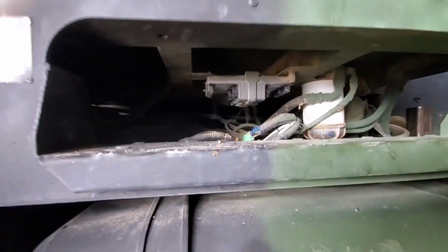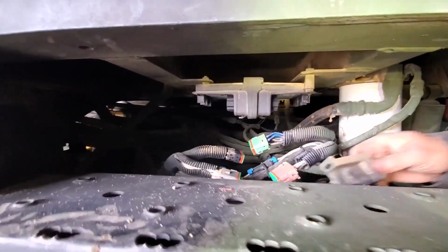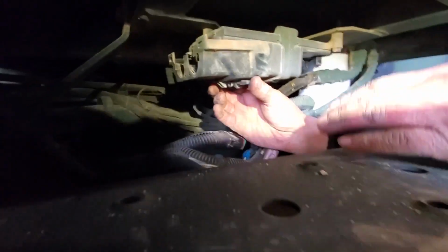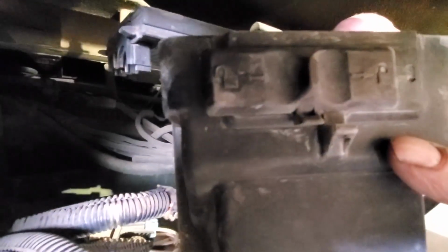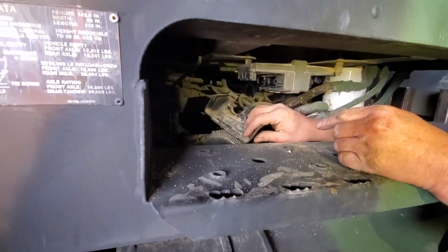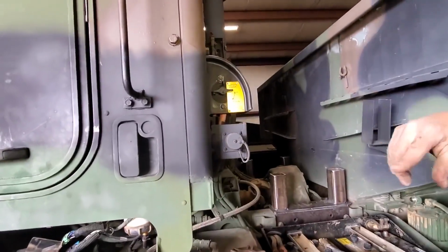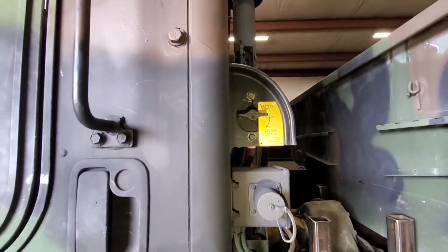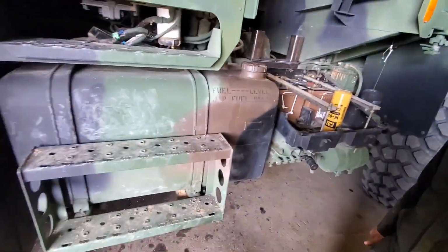So now, there's one under here, is that right? This is your ABS module. There are 4 plugs, and they are color coded. To undo them, they have a cap that snaps on, and these locks you slide side to side. They have a picture on them. Got it. So you can just remove them and pull out your 4 plugs. Shut off your power before you do any undoing of the modules. Disconnect your batteries, positive and negative terminals. We only have 2 of the batteries in right now. The rest will come in later, but just disconnect those terminals for sure.